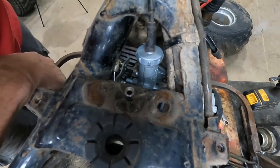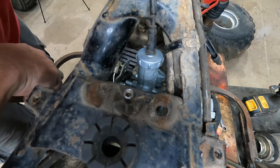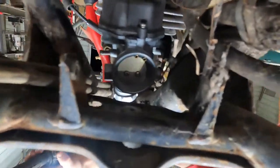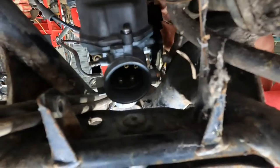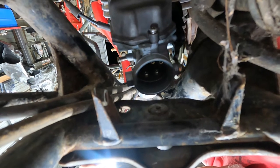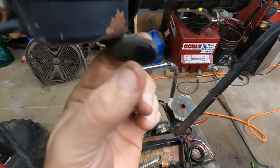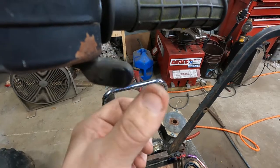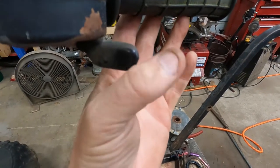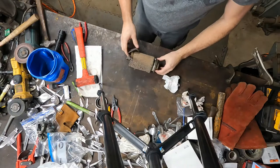When you get done putting your carb back together, listen for a little pop — that's the slide bottoming out. I'm going to put the camera in so you can see the slide going up and down and hear that little pop. That's what you want. On your throttle, you want a little bit of play — where it's not actually moving the slide at all — so you can bump it without it being too responsive. Then make sure you've got full throttle travel.